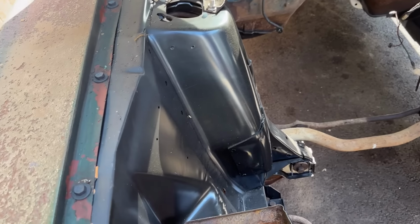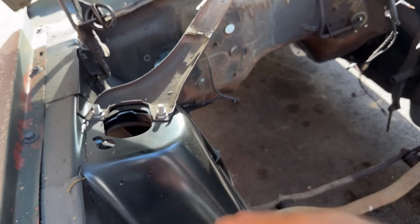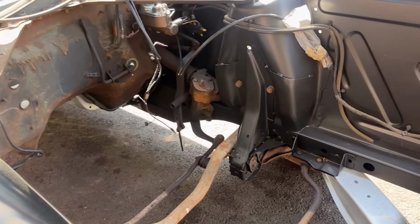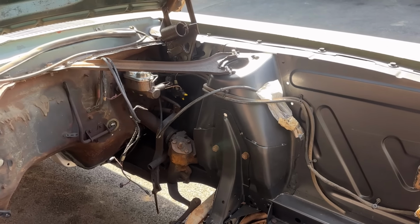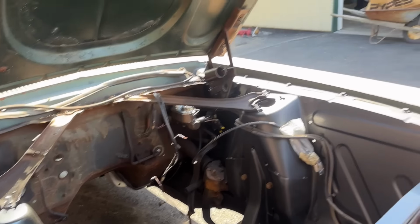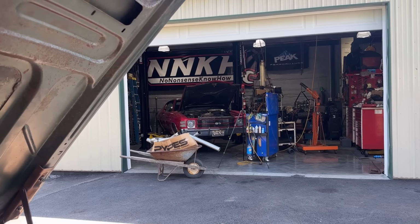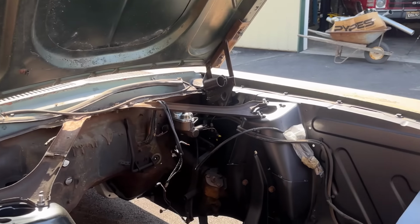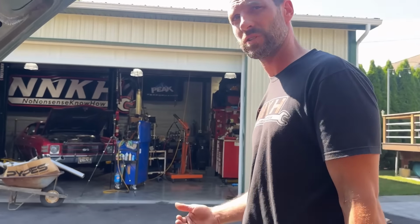Look at that. Yep. So not in a massive rush to get it done, but I definitely want to get it done probably within the month. I'd like to get some good cruising days out of this in the summer. So what are you planning on putting in this? I think I'm going to just slap that 289 back together, replace a few bad valves, rockers, new gaskets, reseal it, new oil pan that's rotted through, and bare minimum, just get it back with the 3-speed in it.